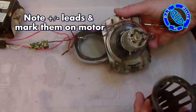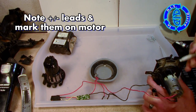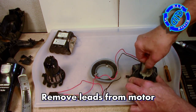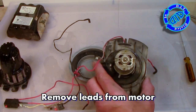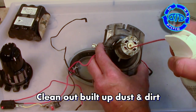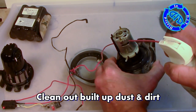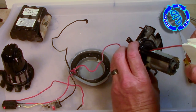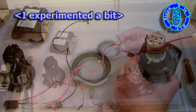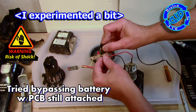Whenever I'm opening a motor out of a device, the first thing I like to do is see if there is a positive and negative designation marked on the motor. If there's not, I mark them myself. Once I have that done, I'm gonna remove all the wires, take a closer look, and then work at cleaning this up. Get a can of compressed air and clean out all the dust and dirt just like you're cleaning out a fan in a computer. As you can expect from a motor inside a vacuum cleaner, there was a lot of dirt built up on the inside, and I'm glad I cleaned it out — it gave me a good chance to get a really good look at the motor and realize it's in good shape.